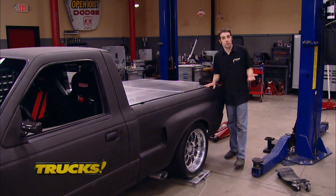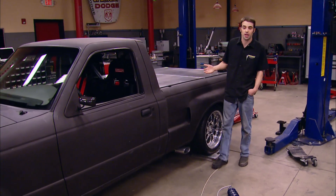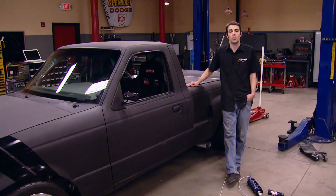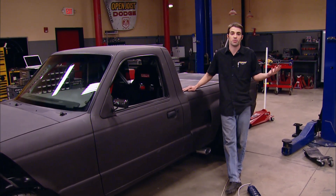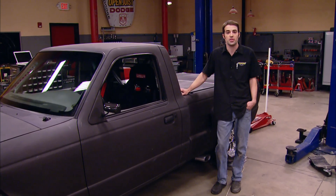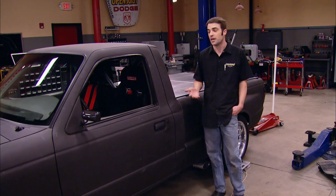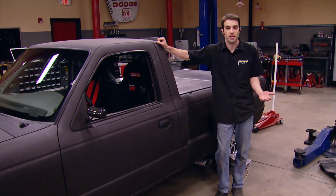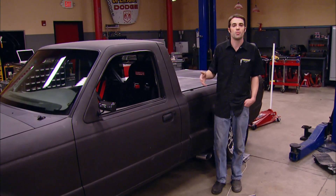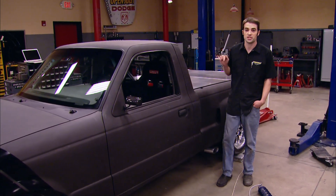Welcome back to the shop. We showed you what we did for an anti-roll bar on the rear, but we haven't installed one up front yet. When selecting a sway bar for this custom application, we don't want to just grab one out of a catalog — we want the right spring rate. One of the key pieces of information you need is the center of gravity height. You've probably heard the general rule of thumb that CG height is about where the shifter handle sits, or about the height of the camshaft in the engine block, but those are more suited for car applications. Rather than go with a general guideline, we're going to take some measurements and know exactly where it sits on this truck.